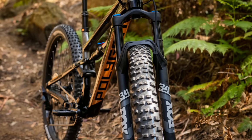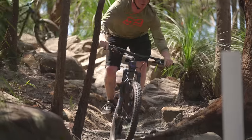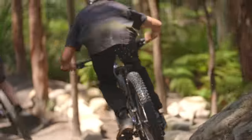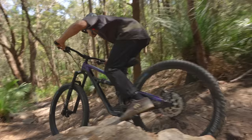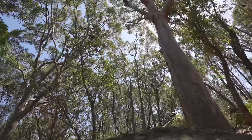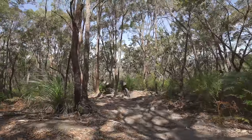But in practical terms, how different are they really? In terms of the rear shock I'd say they perform pretty evenly, but the main benefit going up to the T8 is definitely the fork. The Fox 34 is just that little bit stiffer thanks to those thicker stanchions — 34 millimeters on the Fox compared to 32 on the RockShox Recon. The Fox also has a little bit more adjustment and the damping is just a little bit more sophisticated and controlled when the trails get rough.